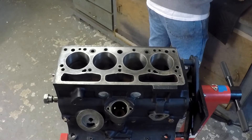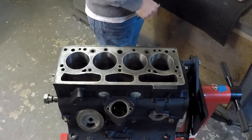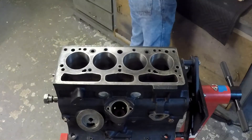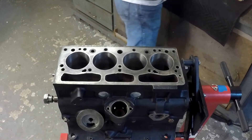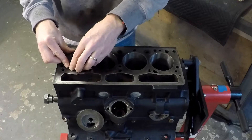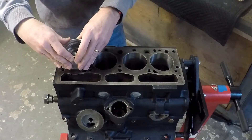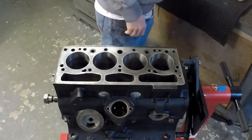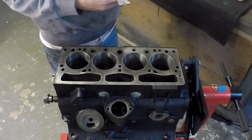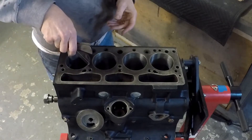The rings I checked in cylinder wall number one I kept with piston number one, and so forth. I also noticed I'm not wearing gloves here — I had problems with the gloves getting stuck between the cylinder wall and the ring. I edited out the portion of me fumbling around with the latex getting stuck in the cylinder wall. It didn't work well, but I didn't have any problems with the rings — they fit just fine.